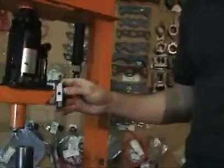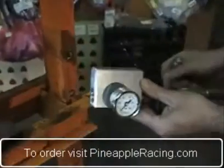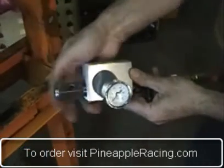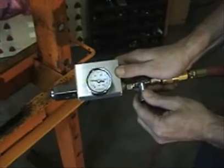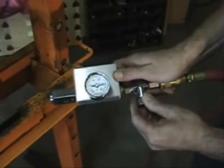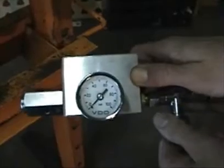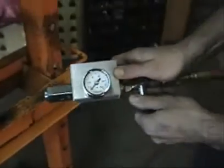There's our finished regulator. Now I'll bet you're wondering how we know how much pressure this regulator makes. The way we accomplish the testing is with a special tool that we've made — we simply thread the regulator into the special tool and, by using air pressure, determine how much pressure it will hold. In this case we made 88 pounds, a substantial increase from the original 68 pounds that we had measured earlier.